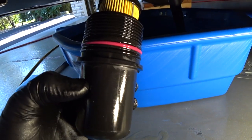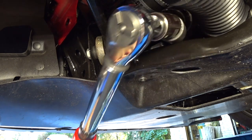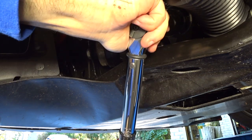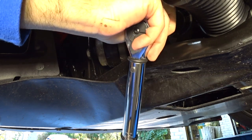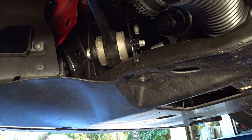Here's the filter cartridge prepped with the new O-ring and AMSOIL 5W50 on the sealing rings and inside. We're going to install it now and torque it to factory spec. The customer wants me to use the torque wrench — I have a 3/8 drive torque wrench with adapters and swivels. Torqued to 24 Newton meters, that ain't going anywhere. As soon as the torque wrench clicks at 24 Newton meters, you're done.